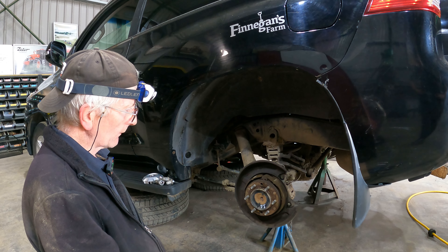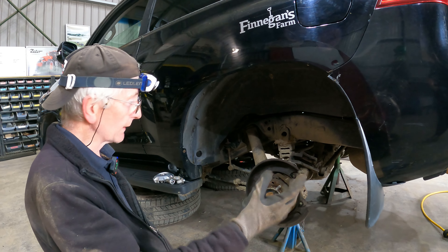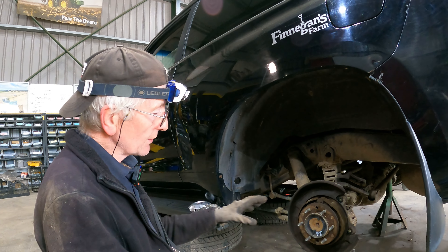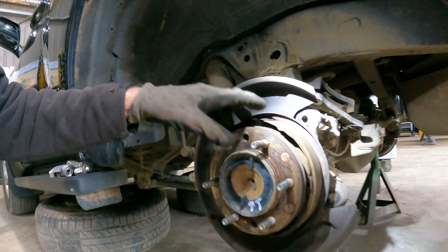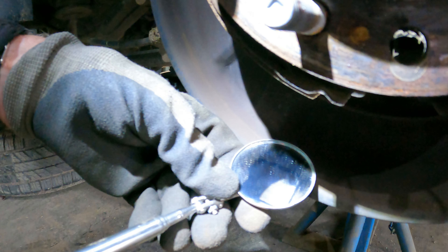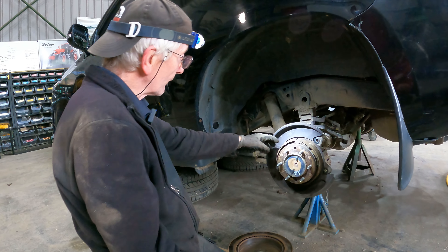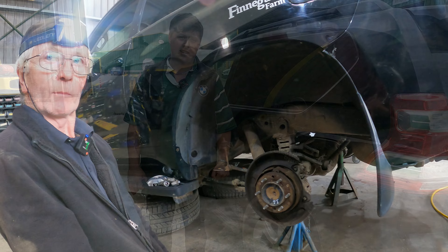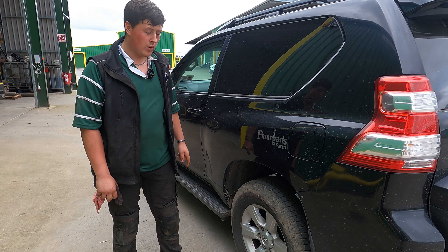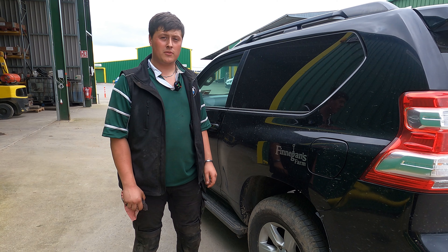We're here this morning at the Land Cruiser. We went to move it and the handbrake was locked on. Released it the usual way — back and forward in reverse — and it just let go. But when you pull the handbrake slightly it was snatching. I checked the shoes here — springs are okay top and bottom. The shoes weren't chamfered; they had a straight edge. You can see it here in the mirror. That dead straight edge causes what's called self-servo application. So what we do is chamfer the edge with a file and hopefully that will cure our problem. Land Cruiser is fixed now, thanks to Mick our personal Land Cruiser specialist.